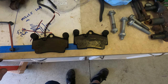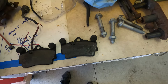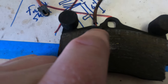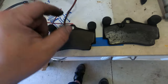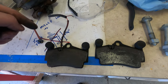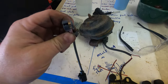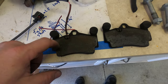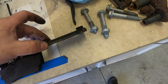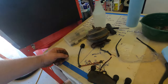This rear is a really good example of how these wear sensors work because there's already a bit of a lip on that rotor — I'm probably pushing it a little bit reusing it without even turning it down, but it'll be fine. You can see right here there's that vertical channel that the wire sits in. It hasn't broken the wire yet, but once it breaks that, now it's not continuous — this one wire will go through one of these sensors on each pad in series, one after another, and if any of them break, you get a warning light. The rears are probably going to set it off again prematurely because of that lip on the rotor. But really it's not that expensive, and to me when they do trigger next, we're doing new rotors.